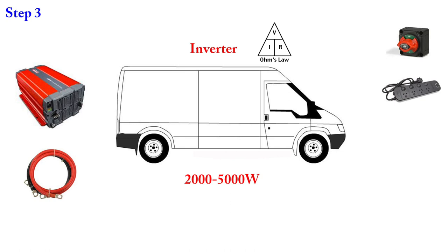That switch allows you to run two different systems — 12-volt and 240-volt or 110-volt. Next, buy some power boards — one or two is sufficient for the back of a van. Get ones with individual switches so you can turn on only what you need, rather than having everything drawing juice automatically. That way you use less power and the inverter won't struggle on startup. Power boards with USB ports are a handy feature and only cost about five dollars more.